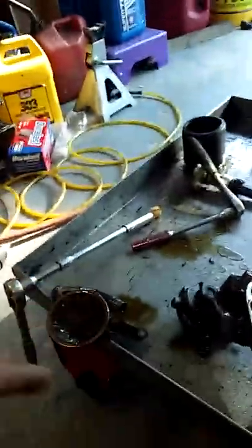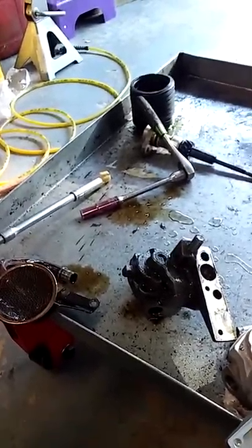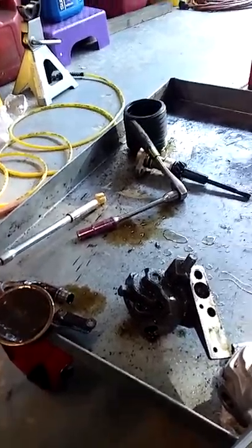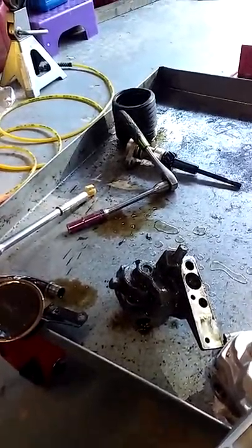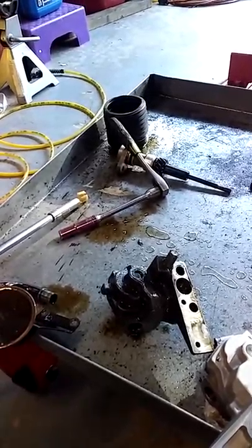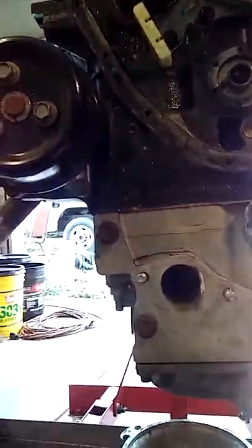Really and truly, it was that pump — just 80 pounds of pressure. I mean, you sit it at idle and it was pumping 45 to 60 pounds, and then when you were actually running at 55 miles an hour, 80 plus. So she was squirting oil everywhere.